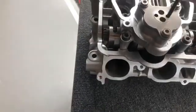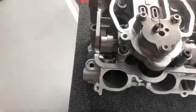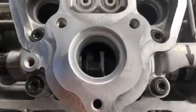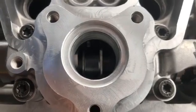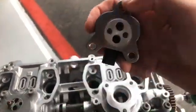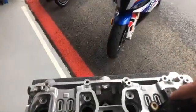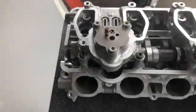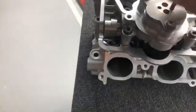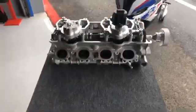I love watching that — I can watch that all day. I've been doing it all morning. So simple, yet so clever. Just to show you this again: in the top here, this is how they're moving the cam across from one way to another — all from this solenoid. They're the two pins. For people that have just joined: there are your pins, one side and the other. That sits in the top, and that's simply dropping the pin either one side or the other to move that cam from soft cam to hard cam. Simple as that. Why hasn't it been done before? Who knows.